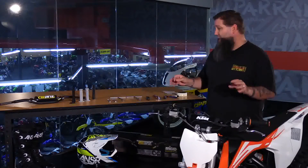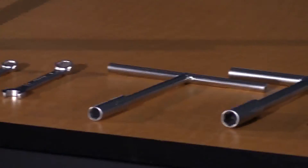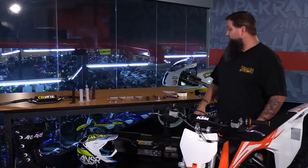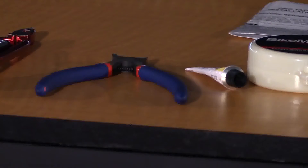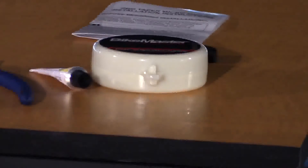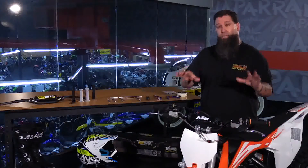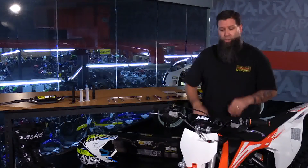There's not really a whole lot they can get hurt with. Basically all you're going to need is a couple of box end wrenches or T-handles, probably an 8 and a 10mm, a screwdriver, safety wire pliers, wire cutters, some grip glue, and some safety wire. Before you start, you want to take some pictures of how everything is stock on the bike so that you can put everything back in the right position.